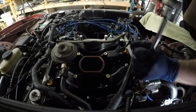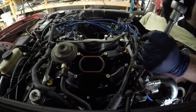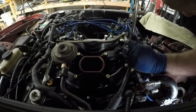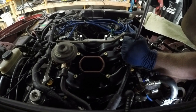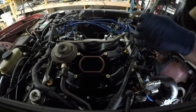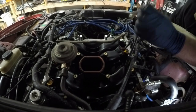What's probably happened is it was leaking in the back with the original intake, and so they ran it down and stripped it out, and then they replaced the new one because that was stripped and put the helicoil in, and that raised the back of the intake enough to keep it leaking. It was leaking pretty bad, so that's what I'm guessing happened.